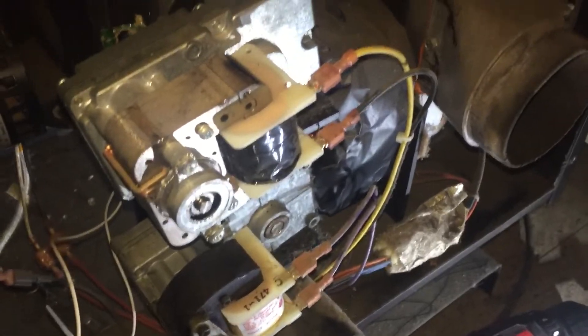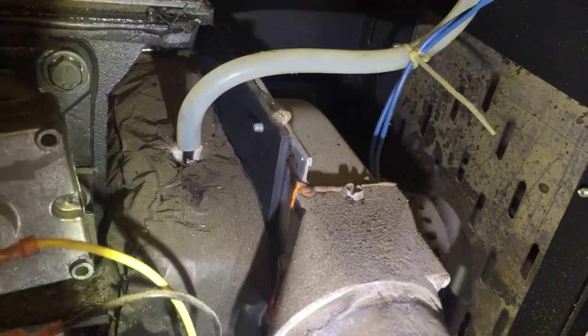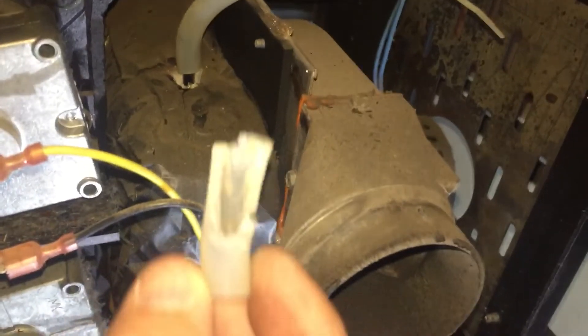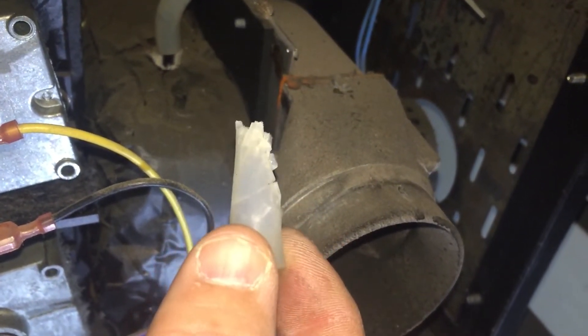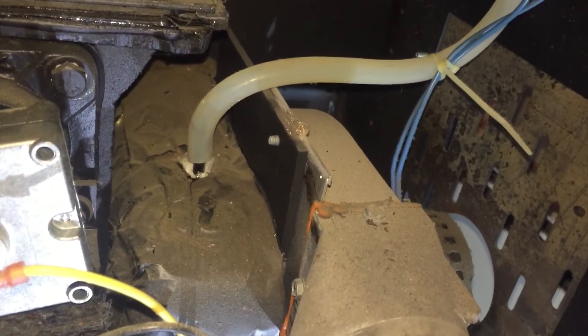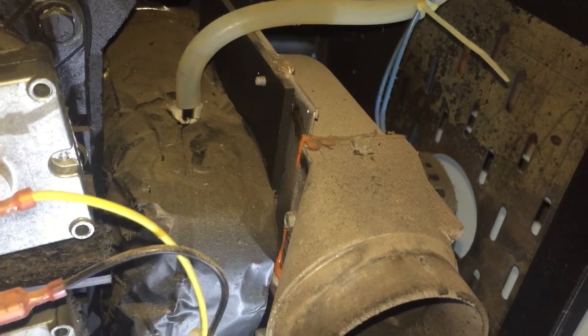What I found was over here — that plastic air hose that comes down — it had dry rotted and cracked from the heat. So I just took a pair of scissors, cut it, reattached it right back on, and now it's a nice snug fitting.